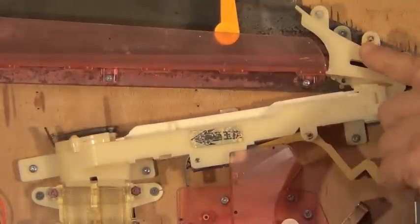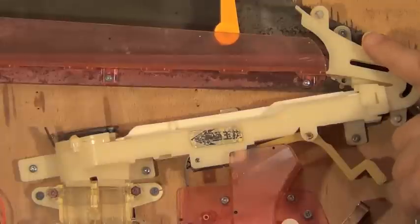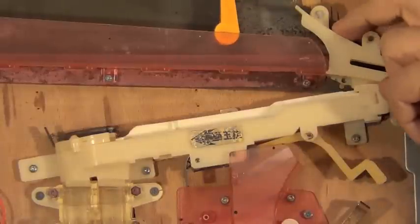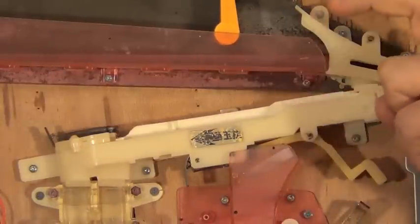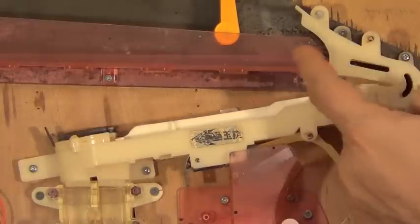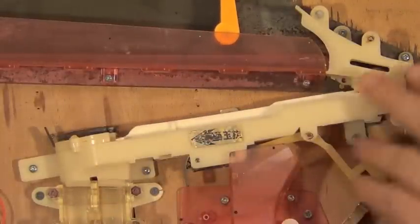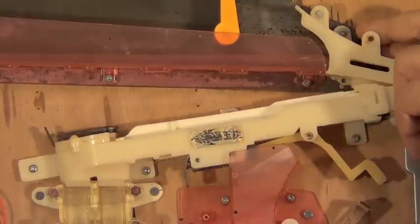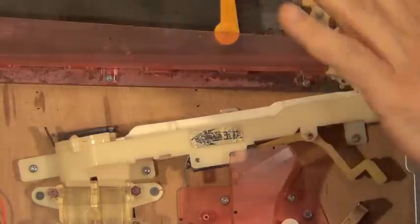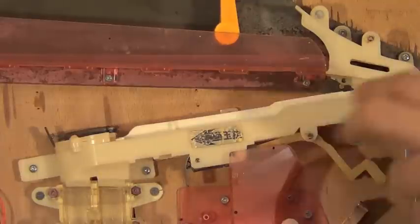As balls enter the turn, on most machines there is usually a red or clear fork right here. It will have two prongs because there are two tracks, and that fork will bend — you can manually pivot it down and it will block the flow of balls from going into your track. This was designed for pachinko parlors where attendants could flip it down to keep the balls in the machine while they service it.